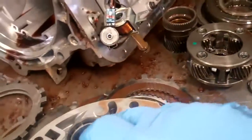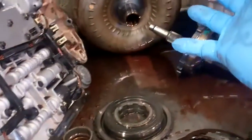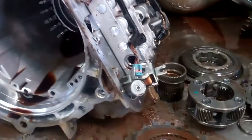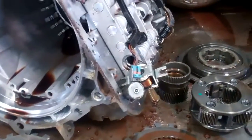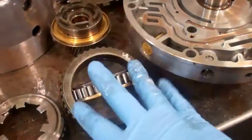And what that did, essentially, is it caused a cross leak, which then inhibited it from getting lockup. And when that happened, if you remember, I was telling you the intermediate gears — first, second, third — started doing things they're not supposed to be doing, which then burned up the clutches. And that also basically damaged your sprague as well.